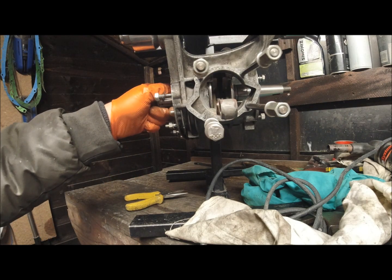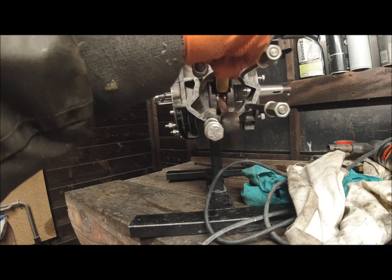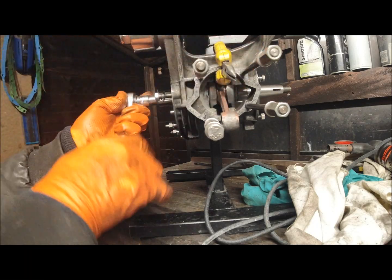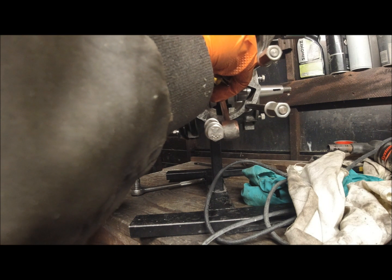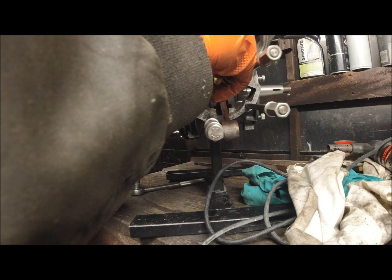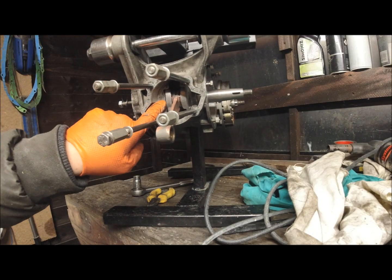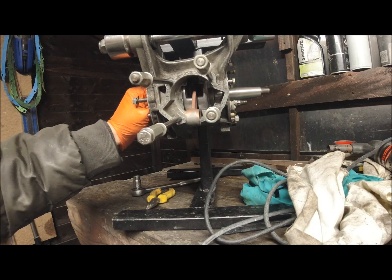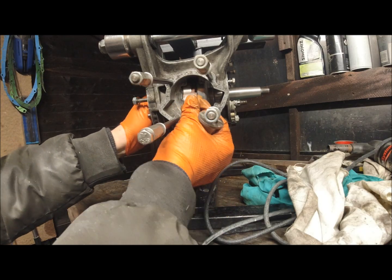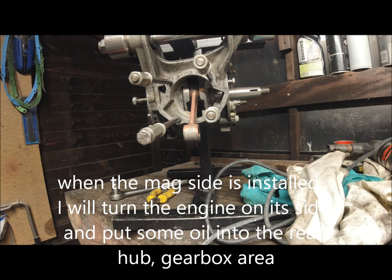Brilliant. So all I've got to do now is lock that off on the top and take the drive side bolt out. So just stick the screw, well, whatever you've got, basically plastic, rubber, like that. There you go. It's not even that tight. And take the shaft off again, just use that as your pulling tool basically. And if you can look there, the crank is rotating pretty freely. I mean, I did spray quite a lot of penetrating oil, 3-in-1 oil on it, so it's turning nice and free. Yeah, and we haven't hit anything, not crank wise anyway.